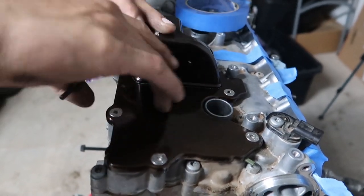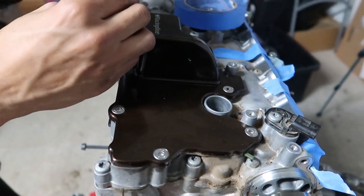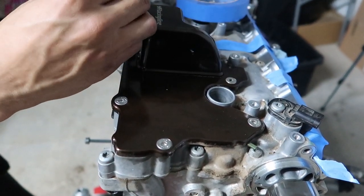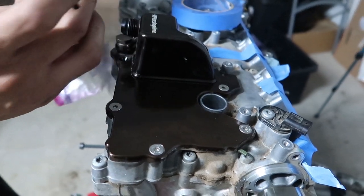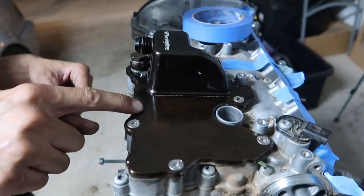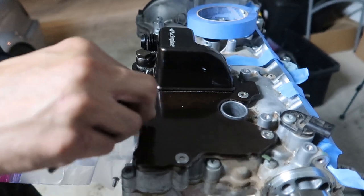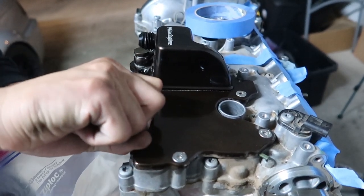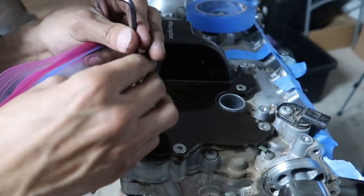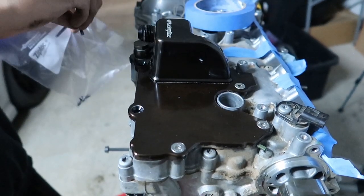All right. Go ahead and take this off. This is the PCV plate. This is the V2, I believe, of the Racing Line. I think they're at V4 now. They changed the position of this little barb fitting. The new one, this part of the plate attaches to this plate, but the screws are underneath. I think a couple people had failures when they didn't tighten them enough or didn't put Loctite on them, or I am going to assume both, and the bolts came down and went right into the cams. So they wound up revising it, and I think they revised it again after that.